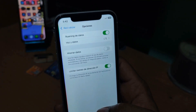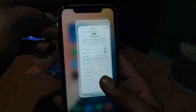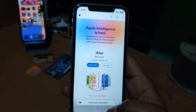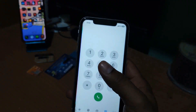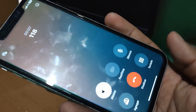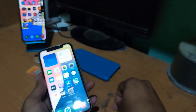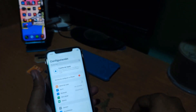In my case this is an iPhone XR so I use option number one. However, if you have an iPhone 12 or later you can use option number four. You select the carrier and perform the unlocking process. I need to activate data roaming — without it the data won't work. I have to force this configuration because otherwise it won't let me get past this message. With data roaming turned on, let's try a web page — there it is, everything is working correctly. Let's make a call.